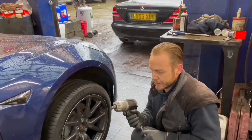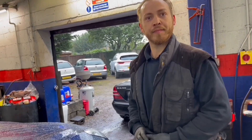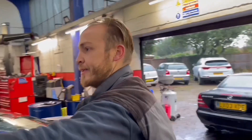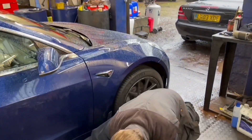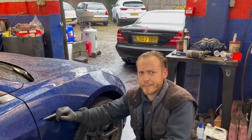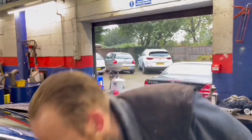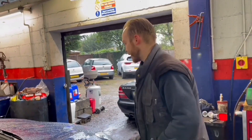At least you know these can't be done with just any jack — you have to have jacking blocks, and you have to have it on a ramp, otherwise you couldn't get underneath the car. Most jacks don't reach. I wonder how much damage you'd do without the jacking block on the battery — a new battery for this car is about £10,000. So it's always important to make sure you have these. I'm going to torque it up to the correct torque — 175 Nm for this vehicle.